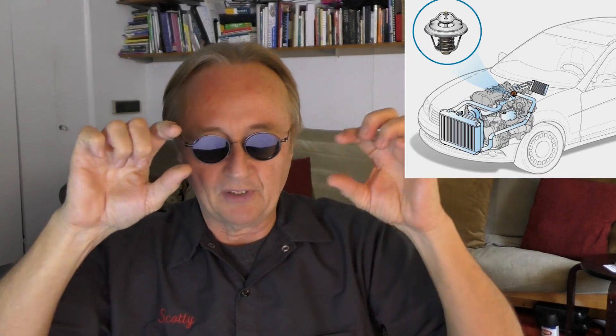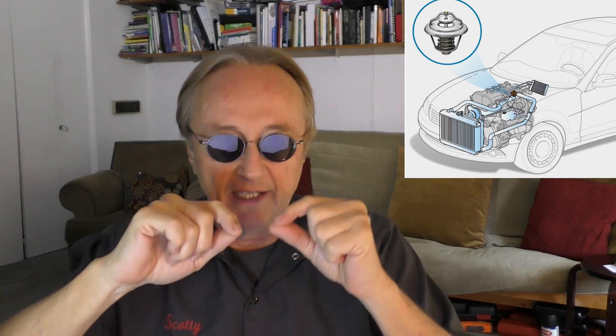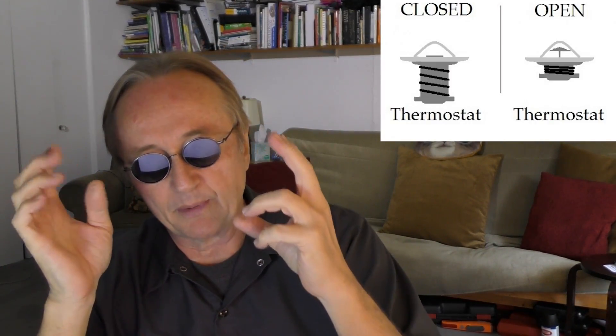Alan says: Scotty, I've got an 04 Mitsubishi Galant 3.8. I have a check engine light come on — the code is for a thermostat issue, but it comes off. A few days it's on, it's off. What could be the issue? First, just change the thermostat. Thermostats are little devices that when the engine's cold they're closed, so the water stays in the engine to warm it up faster, and then once they reach a certain temperature they open up — the water goes from the engine through the radiator and cools down. They are mechanical devices in most cars, though some have electronic ones, which leads to a real headache when they break. Most of the time just replacing the thermostat and the gasket will fix that problem 99% of the time. If it doesn't, then you can have a sensor problem, a wiring problem, or even a computer problem.